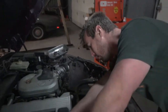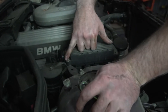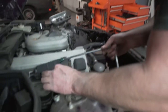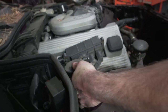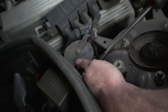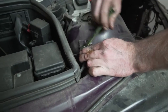First thing we're going to do — I'm actually going to pull the ignition coil with it. We're going to take this guy off right here, and then there are two 8mm nuts right here and right here, so we'll take those off real quick. A good practice is to return all of your hardware from where it came so you don't lose it. We're going to disconnect the diagnostic plug right here — this is for BMW techs back in the day. You pry on this tab right here, push on it, lift up. Next thing you want to do is pull this ground off right here — it's 10mm.